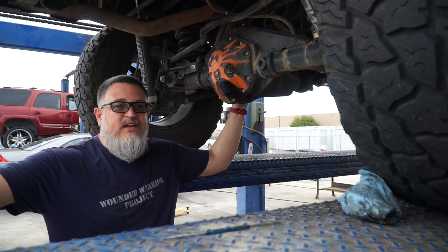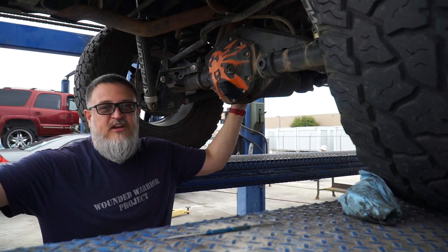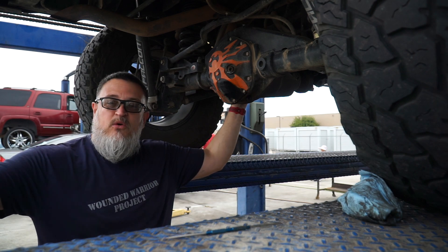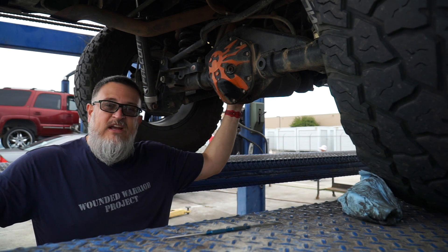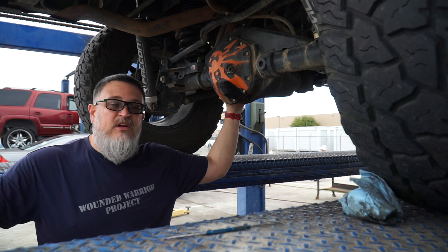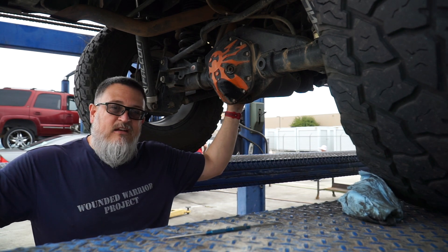So we've just finished it up — took about 10 minutes. Do not be scared to service your diff, and please remember every 30,000 miles it needs to be done. Some would say every 15,000, but I say every 30. It didn't even take as much fluid as I thought — we ended up with about three quarters of a quart left, so this one didn't take quite as much as I was expecting. It's really easy and not very expensive. I think I spent $50 including shop rags, silicone, and everything. Normally with the factory cover, all you use is silicone — you don't even use a gasket. So really all you need is silicone, the oil, and a little bit of time. This is Kevin with Gray Line Overland — hope to see you on the trail.